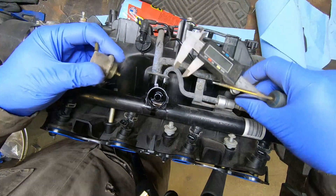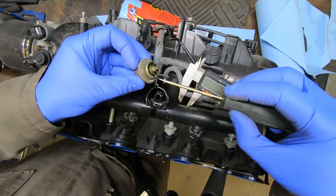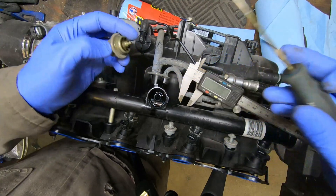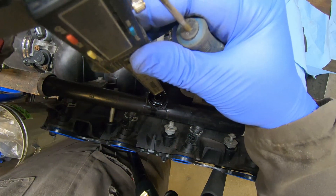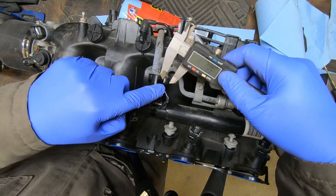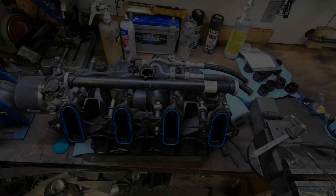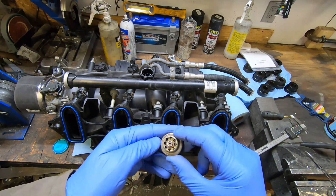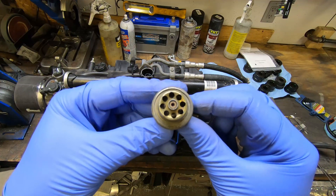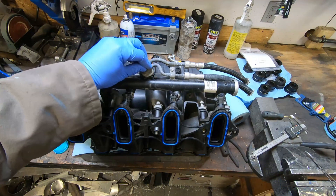I need to confirm there'll be enough gap between the top of this lip and the bottom of the housing. I need this part for the seal but not the spigot, so if I cut the spigot off here, will enough fuel get through? I took a rough measurement with the calipers, then ground that little nub off flush. Now I need to verify there's enough room for fuel to flow when it's seated back in its normal spot.